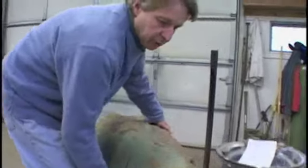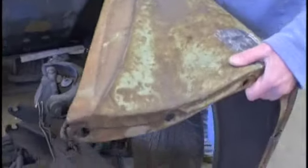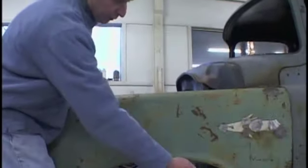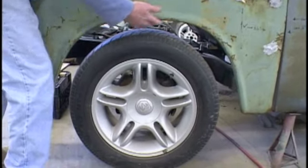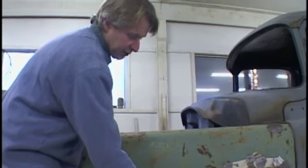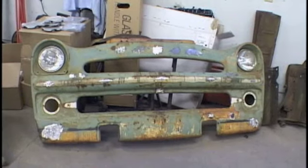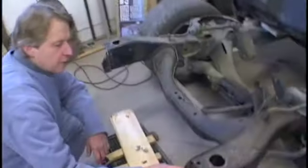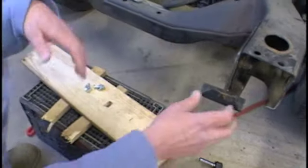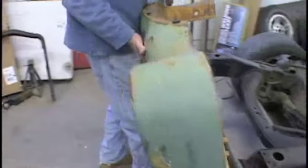The next thing I'd like to put on would be the fender, but this is going to be tricky because it's not going to stay on there by itself. What's really critical now has to do with where the cab sits on the frame — this wheel opening has to be correct with the wheel. The wheel has to be sitting in the right position or this is going to look ridiculous. It can't be too far forward or too far back. Once I get the engine in there, this whole thing is going to suck down and I'll have just about the right clearance. On the front of the Dakota frame, these brackets were part of the original bumper assembly. I thought they might hold the nose piece quite nicely if I cut them and flipped them around — that's what's going to hold the front of the fender.